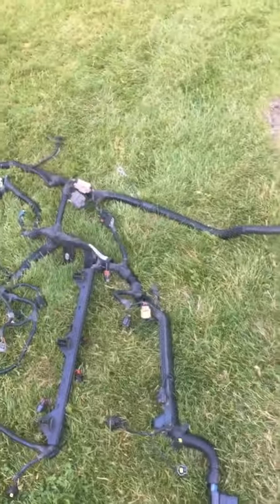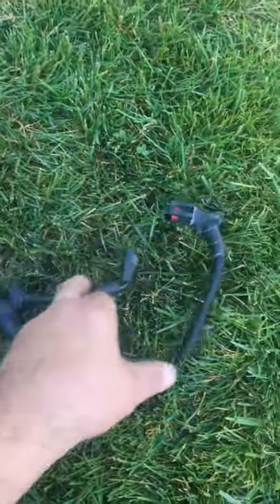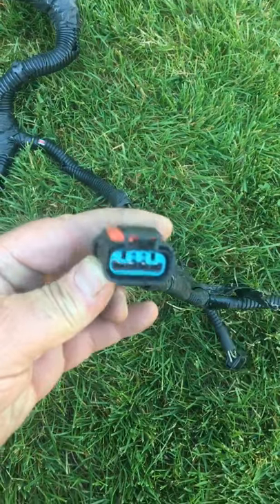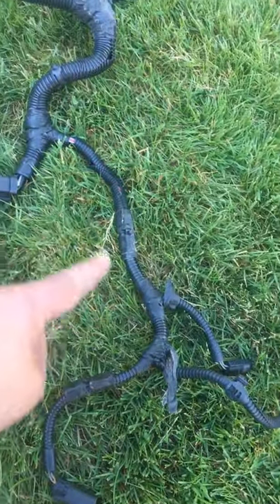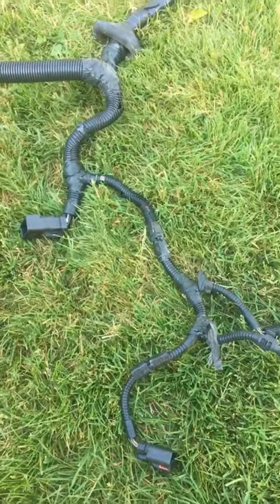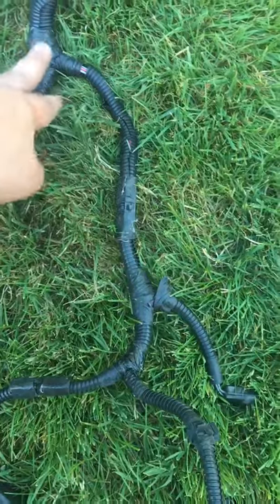Once you've got your wiring harness all laid out and figured out, you have an idea of where she lays. You'll also have all the little ends, caps, and extra parts you'll ever need for anything that might go wrong. Now the surgery starts. The two connectors I have here — these two are the ones I do have, and this is the cruise control connector with those four pegs. I'm going to start taking this apart to work through and create just the cruise control overlay.